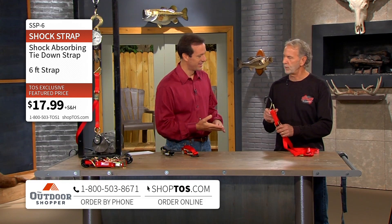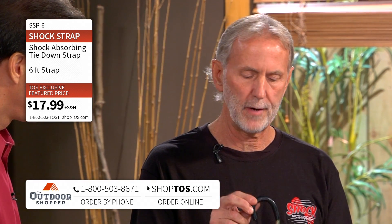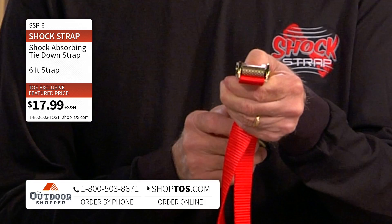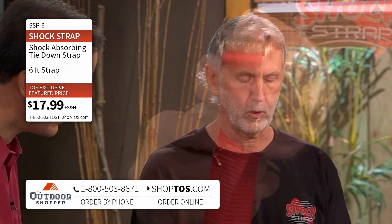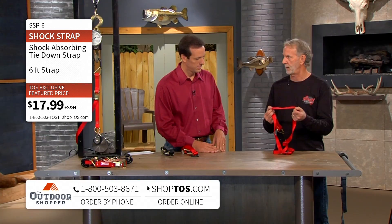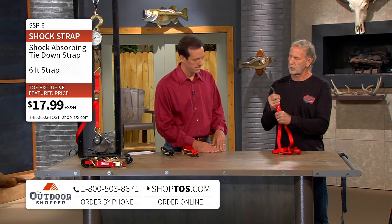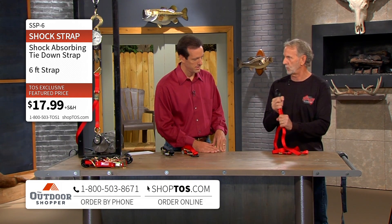Shock Strap is a pretty unique product — you haven't seen anything like it before. We start with oversized hooks that are anodized to keep the rust off. And then we go to the aggressive teeth on the strap itself — looks like a shark. Compared to the other competitors these are very sharp and much longer. And then of course we have polyester webbing rated at 3,800 pounds. The whole idea is I don't want this to stretch at all — I want the Shock Strap to stretch. It's a very durable product, very hard and inflexible.